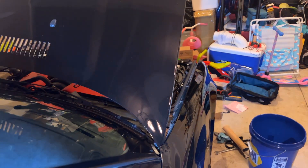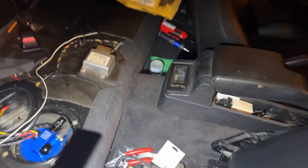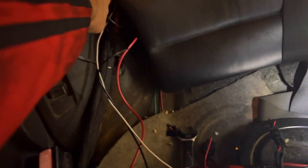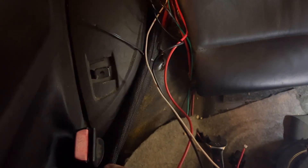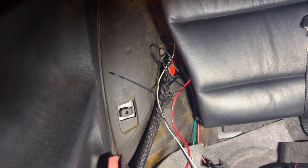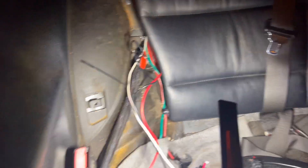Let's go to the back of the car. That wire you can wire up a few different ways — you can come through and go underneath the car all the way through to the back. I did it a different way. For me, it was just easier to go underneath the car. I came up through the fuel sender for my trigger wire, going up and through into where all the other wires are. I was able to feed all my wires in there — my Terminator X comes through there. I also ran my power and ground for the secondary fuel pump through as well. Let's go to the back and show you what that looks like.